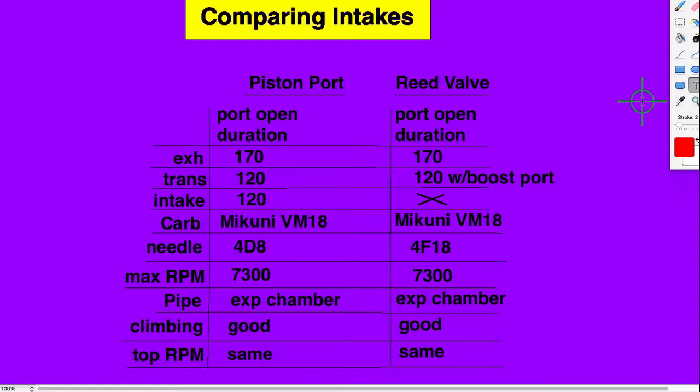These are the specs of the two engines. Like I said, same engine, same porting. I changed the needle on the piston port — a little bit leaner needle. But reading the spark plug on both of them gave the same chocolate brown color. The leaner needle caused the wide open throttle jet to be a little leaner too, which is typical for a piston port because it has a stronger wave front when the piston opens the port. A reed valve is very gently opened, so it doesn't have a strong wave front. The piston port has a stronger suction pulse, so it typically needs a leaner main jet.